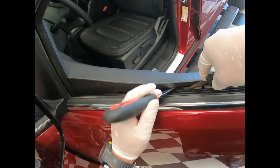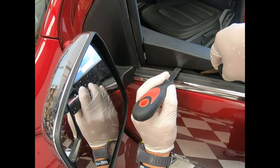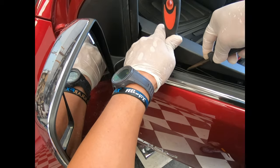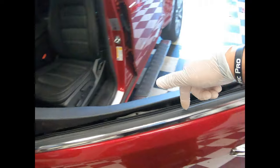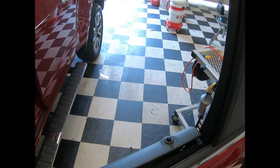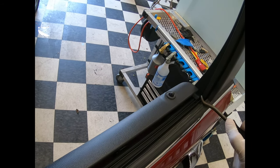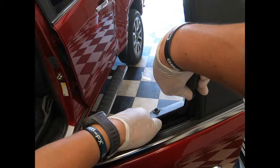Walk them up a little bit more here. There's another retention clip there, so just push them back. There's another one way over here — there he is. We've exposed this, and if you have one of these wedge tools, use it to keep this guy open like that so you can go ahead and remove that. This sweep is going to be in the way — they always are — but the trick to getting around this guy is that he's under this plastic thing right there, so we can move him out of the way very simply.